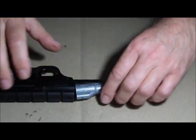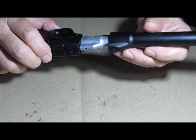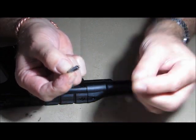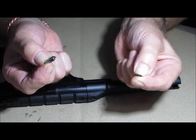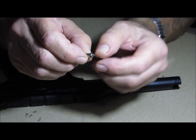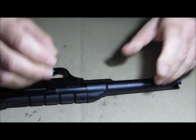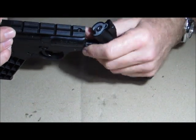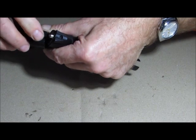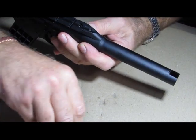Get your lever pin back in. Turn it over — the holes are slightly tapered so they tend to only go in one way. Make sure your barrel is pushed right in — the plastic bit on the bottom with the grooves holds that in place. Next, get the barrel shroud on so we can get that screw in to hold the pin in. Slide that over. Remember the long screw which has to go all the way through. A touch of grease on the pin. You don't have to fully cock the gun — just hold it half-cocked, make sure the slot lines up at the top with the screw hole, push the pin in a bit with your finger to get the gun to lock, then get that screw in.